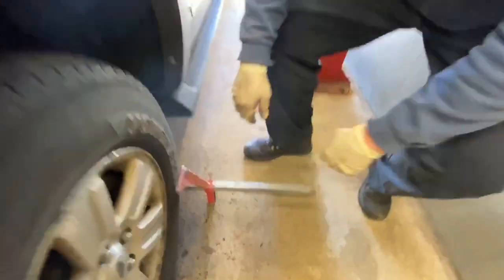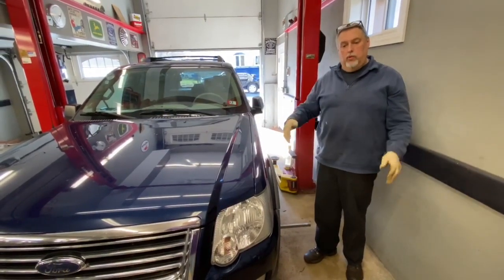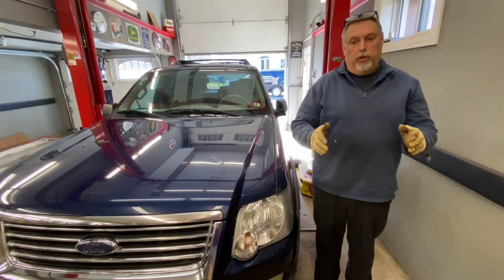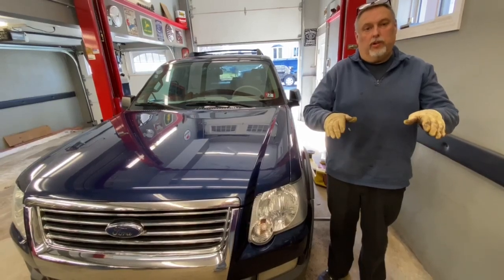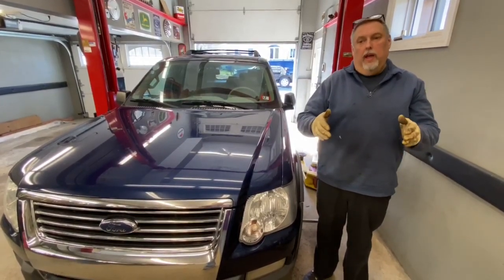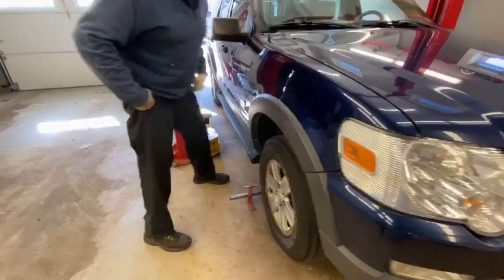So now we're going to take and measure the front of the tires. The measurement from the front of the tires should be less than the rear. When you're sitting behind the seat looking forward, your tires should be toeing in a whisker, so that when you're hydroplaning going down the road at about 50 to 55 miles an hour and the front end starts to lift off the ground because air's coming under the car, your tires are going to tend to want to flare out. That's why you always have the toe set at 1/16th of an inch, or 5/32nds. Now we take the toe bar and come around to the front to measure.